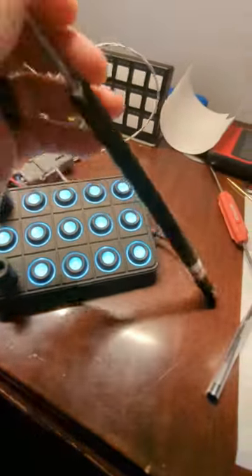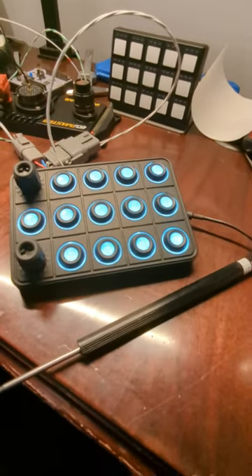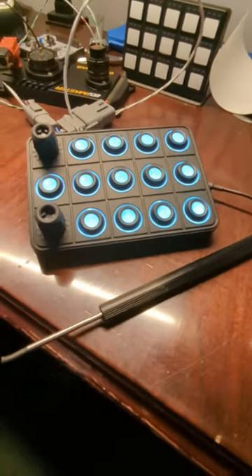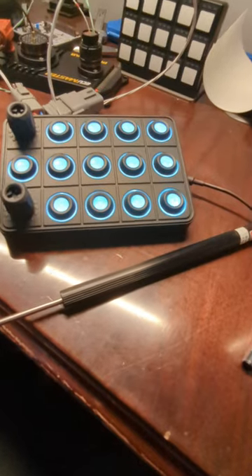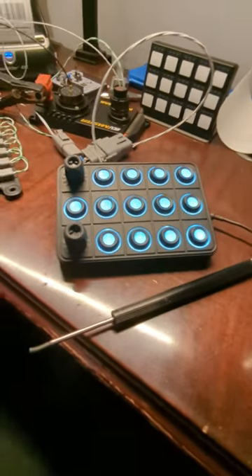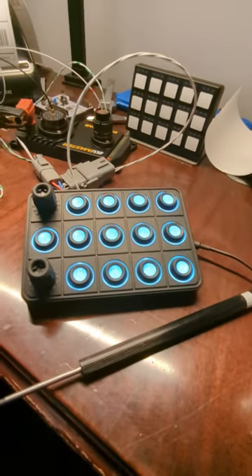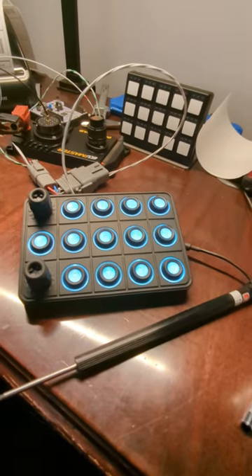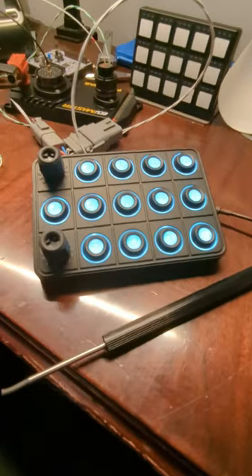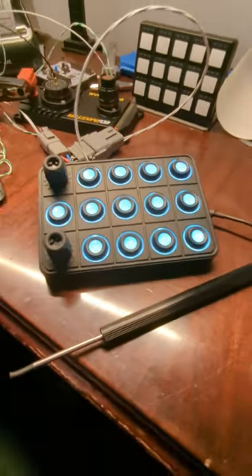The analog inputs for this keypad are pretty low resolution — it has 100 steps from 0 to 5 volts, and it only sends data at about 10 hertz. So it's nothing I would use for high-speed, high-cardinality data. You're not going to use it for a brake pressure sensor, MAP, or anything like that. It's for something very basic at best.